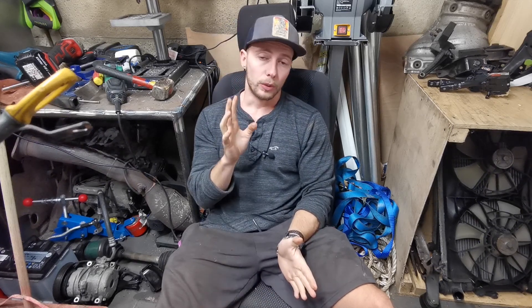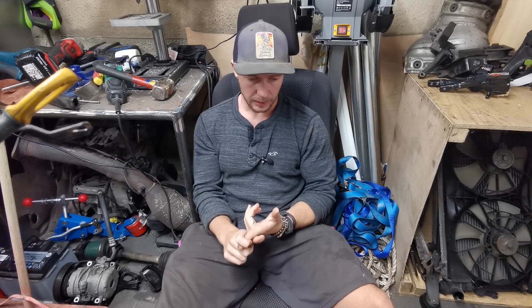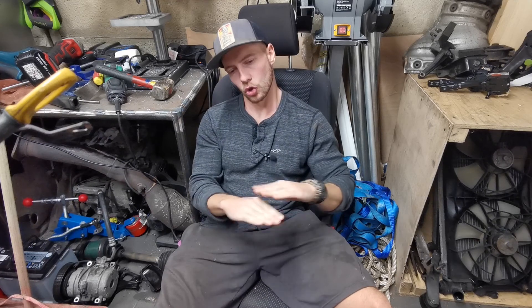What's going on guys, back again. This episode we are going to be looking at the Yaris - we're going to get that swapped into the place of the Celica and start stripping that down, which is scary because that's actually a running car which I quite like driving. We're also going to be looking at the final bits off the Celica - ignition barrel I think is the only component - and I'm going to reciprocating-saw the lower front cross member, which takes the front torque mount and stops the engine rocking back and forth. I'm going to cut that out of the body of the blue Celica out there because the Yaris doesn't have that.